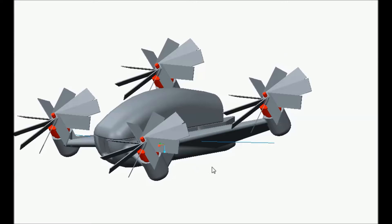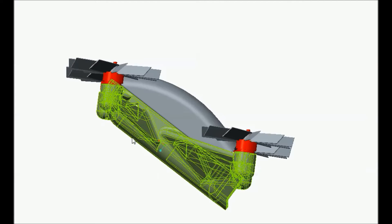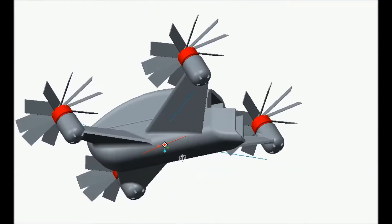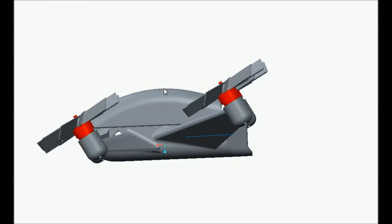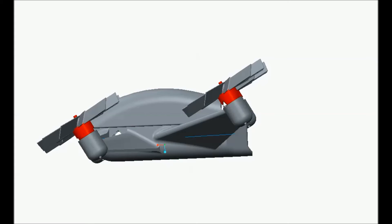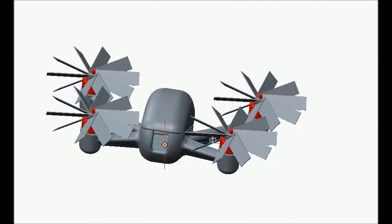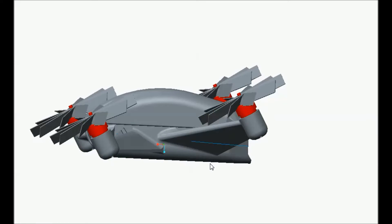In this airframe, the takeoff position is angled, and the flight controller has a ledge inside so it thinks it's flat. The rotors are both flat but one is higher than the other. When flying forwards, the frontal area of the device is reduced. The motors sit on arms which are little wings with aerofoil cross-sections, set at a five degree angle of attack in full forward flight — and they generate lift.